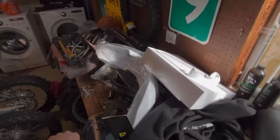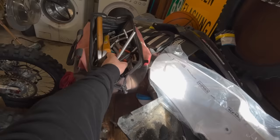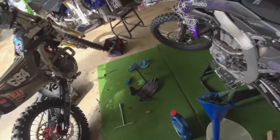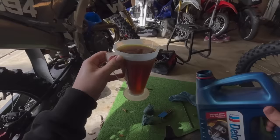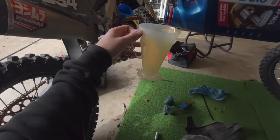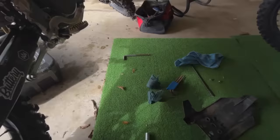Dialed. Got too many bikes in here, I can't even get to my tools. Going to get a first try — give it to 14. Feels like a 12, looks like a 12. There it is, it's hiding. Too many tools. Got paper towels in my funnels — making sure there's no dirt. Grab some Delo here. Quick 500ml, then 500 into another 250 — going the full 1250. It's cold out, look at the viscosity, this thing's so thick, it's going down so slow. Quick another 500ml. We have just enough to get the job done. Another 250 — there's like 10cc's left. When medium goes to change his oil in three months, we'll have 10cc's of that left in there.